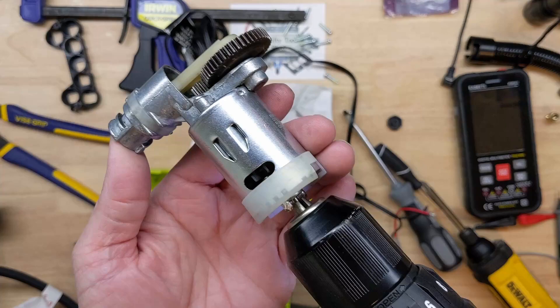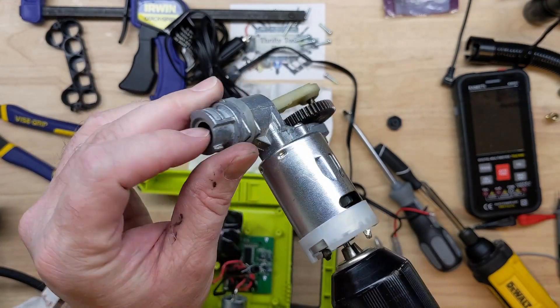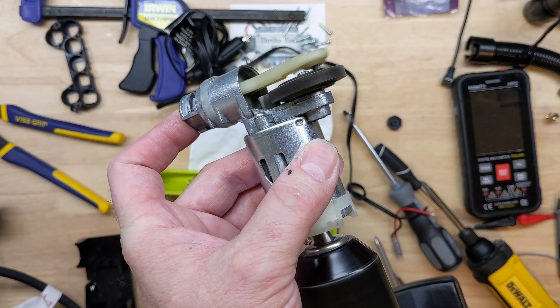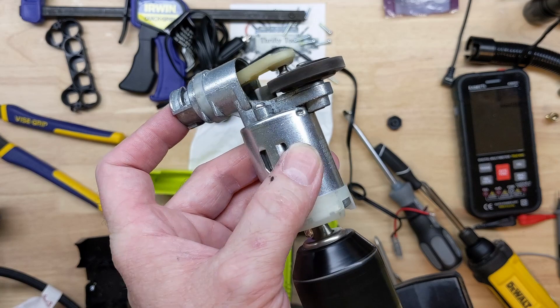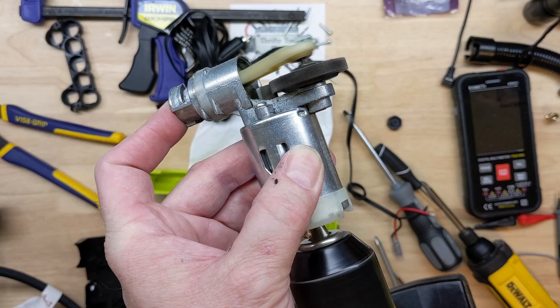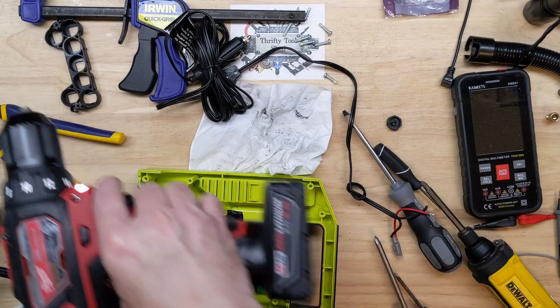Back with a drill hooked to the back of the motor — the check ball is just stuck in there. I don't really feel a lot of pressure build here. Even that test with the flattened seal was short-lived; it's not going to last long at all. It's definitely not what I'd expect from a positive-displacement pump. So this is not going to be a repair video.